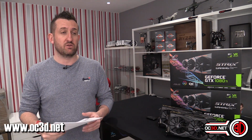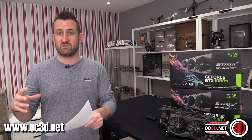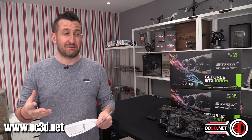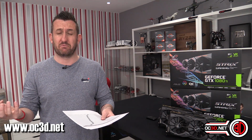And the other thing to consider is the fan doesn't spin up too much and make more noise than the graphics cards themselves. Now, the reason why I use the RM stuff is the fans, even when it is running, don't really make any noise whatsoever. A lot of the good quality high-end power supply brands don't really make any noise now, but it is something to consider if you've got an 850 watt power supply and it's some horrible generic black thing that's semi-modular and you can't even pronounce the brand. That might be an 850 watt peak power supply that's really like 500 watts and putting disgusting amounts of ripple through your rig.